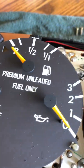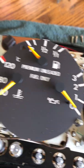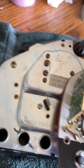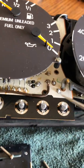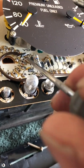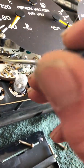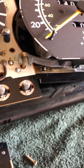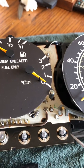Everything else works in here, so I don't think it's related to the fuse. I did have some issues on this board right here — the center console lighting wasn't working. There was a burnt part of this board; I could see it with a magnifying glass. I made a jumper from this connection over to this one using the schematic, and that restored the interior lights — center console and a bunch of different lights. But that fixed that problem.